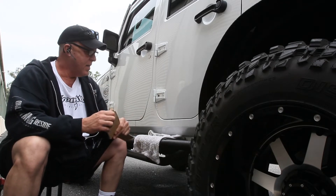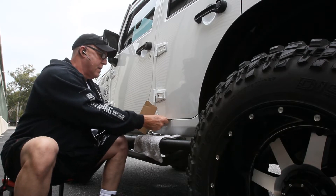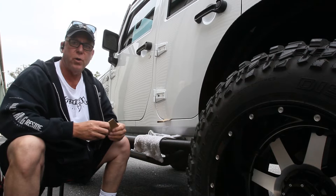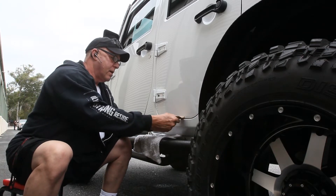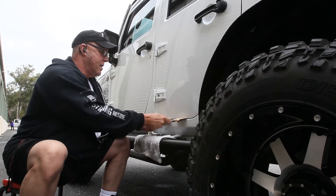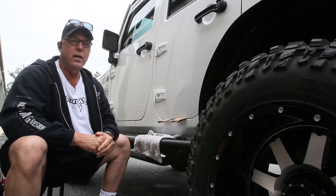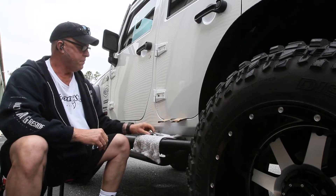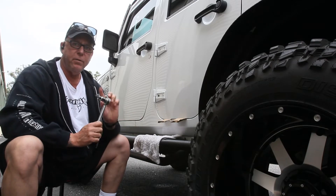The first thing you want to do is grab some cardboard and stick it under your door, make it nice and tight. We're going to take all four hinge bolts out and we don't want the door to drop on its alignment — we want the door to close nicely just like it did before. Just jam some cardboard in there as a good precaution so you don't change your door height and have to worry about readjustment.